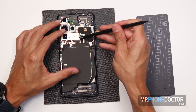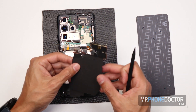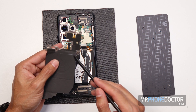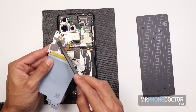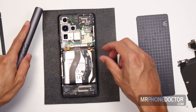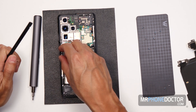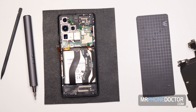Now let's go ahead and remove this QI flex so we can reveal the flexes on the OLED. You can see this one has two little attachments. This one's weird because it looks like it's not even connected — this is like another little QI or something. It's got a little heat-resistant pad right here; that's where the IC chip sits, so maybe that has something to do with the IC. We can now remove these flexes for the main OLED. And you can see all your 5G antennas here — this must be a 5G Verizon. Sometimes the logic board's a little bit different too; they have little pins coming out on the frame.